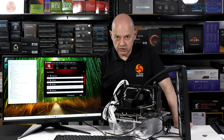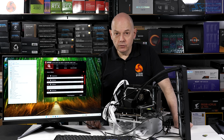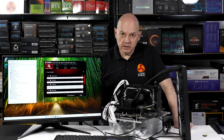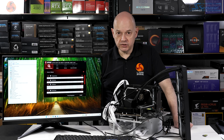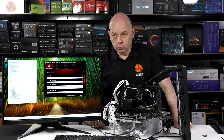The next step is to install drivers, both those for the general Intel platform and those specific to, say, the networking chips in your motherboard. There are three ways that occur to me to do this, because Windows Update at the moment is utterly useless because it doesn't know about these platforms. So one is to head to the motherboard manufacturer's website, look at the specific motherboard that you have, go to the support page, download drivers, and that will certainly get your PC running, or running better.